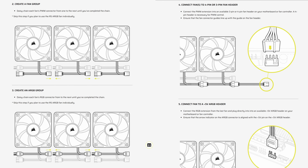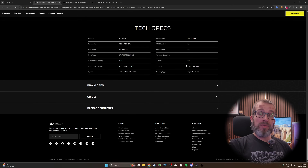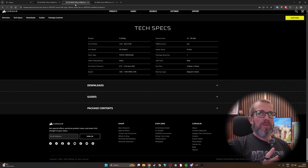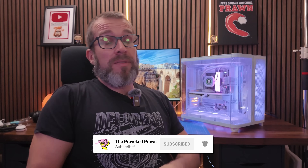I made an assumption, and even Corsair's guidance says to just plug it into a fan header and that'd be fine. However, looking at the specs, Josh is in some ways right: the RS120 fans draw 0.4 amps each, meaning three together draw over one amp. The RS140s are 0.45 amps each, so even more. If your motherboard header only supports one amp, connecting three daisy-chained fans means you're trying to draw more power than you should be.